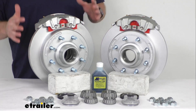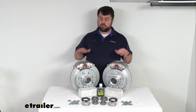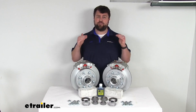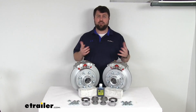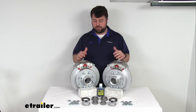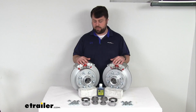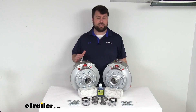These are high quality automotive grade construction so they are going to be very long lasting. Now one caveat with upgrading from drum brakes to disc brakes is that disc brakes require a higher line pressure, so you are going to need a hydraulic brake actuator and brake lines rated for 1,500 PSI or higher to properly activate these brakes. If your trailer is already set up for drum brakes, it's pretty unlikely your system can handle that pressure, so you will need new components. If you don't already have a hydraulic brake actuator and brake lines rated for 1,500 PSI, we do have those available at eTrailer.com — they are not included in this set.